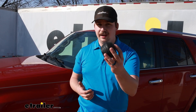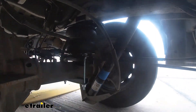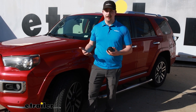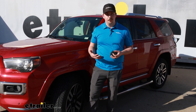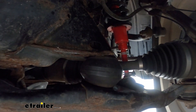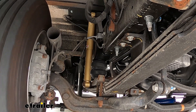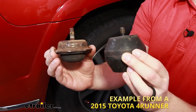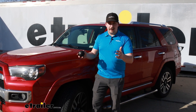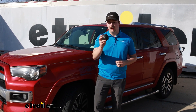So why would you be looking for something on the front end of the suspension enhancement side? A lot of people are pretty familiar with airbags on the rear axle. A lot of those suspension enhancement components are used in towing applications or maybe truck beds where you've got really heavy loads in the bed and you need extra support at the back of the vehicle. Now what the front end can do is stabilize that front end if you have something like a front mounted hitch, maybe a plow on a truck, or on a larger vehicle or even a smaller vehicle like this. It does help stabilize body roll a lot because these are going to be a lot beefier than the factory suspension and the factory bump stops, and help limit that side-to-side movement as we're taking turns or driving in really windy conditions on the highway. So this will give a significant upgrade for those applications.